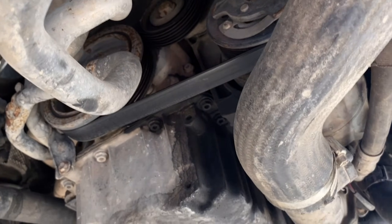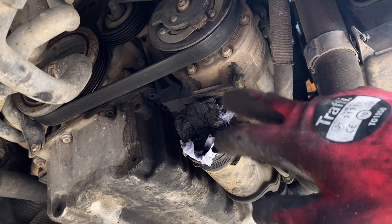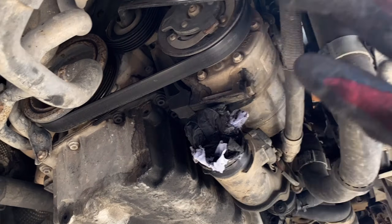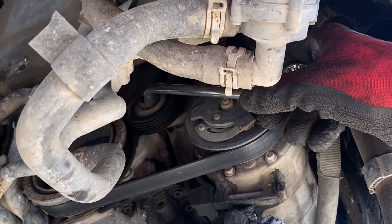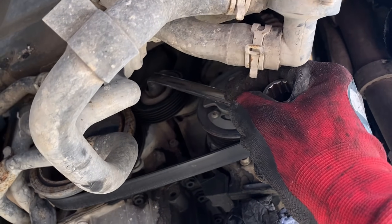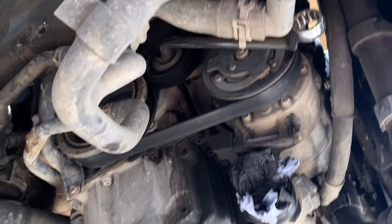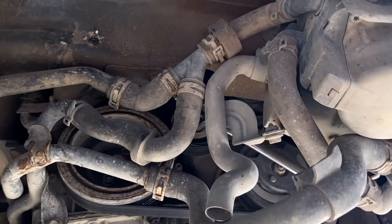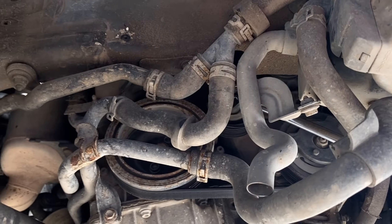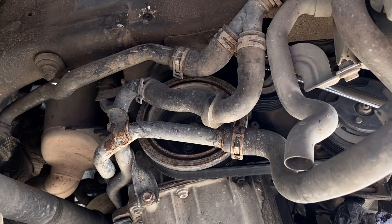Boost pipe out of the way. Don't worry if oil comes out — it's pretty normal on a diesel. I've got a bit of tissue in there so it doesn't make a mess. I've got my 16mm swan neck spanner on the tensioner, as far forward as possible, and I'm just going to pull that forward to de-tension the belt and get the belt off. If you've got a VW Sharan, you're going to have an auxiliary water heater which makes it a bit of a pain to get to the bottom pulley, but you can work around the pipes.